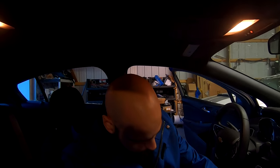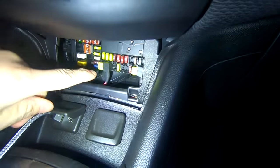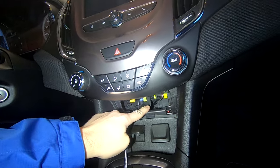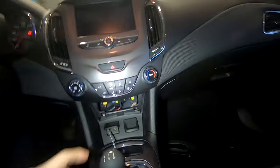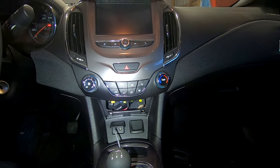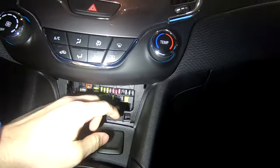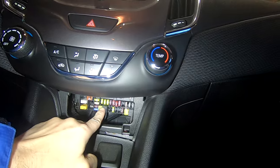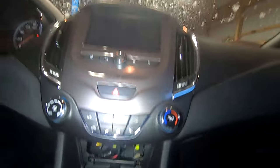Here's the inside of my car. If you want to power your boost gauge, right under here if you pull from underneath - right in this fuse location is where I tapped in to get power. It gives you a 12-volt source and then you can power any gauge you want. It's a perfect spot. It's also switch-controlled, so the gauge turns on with the car. Right here is also where you could tap in - one of these is a switched source, one is a battery source - but that's how I ran my gauge.